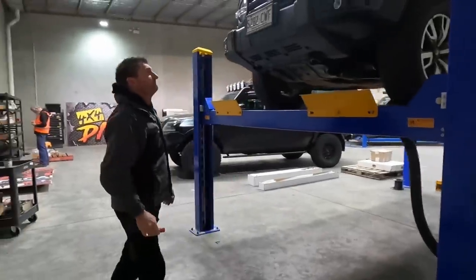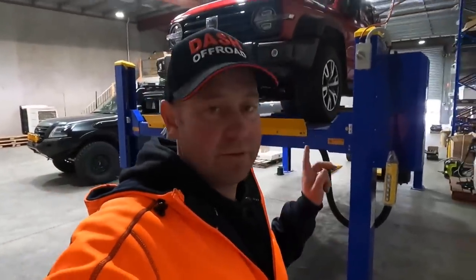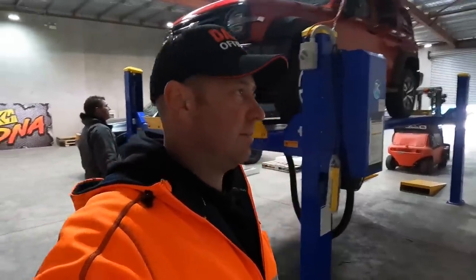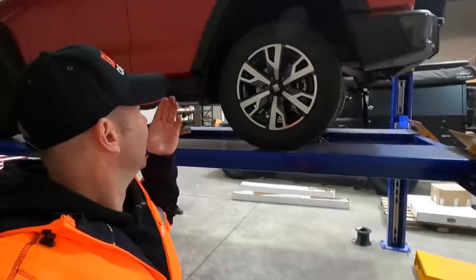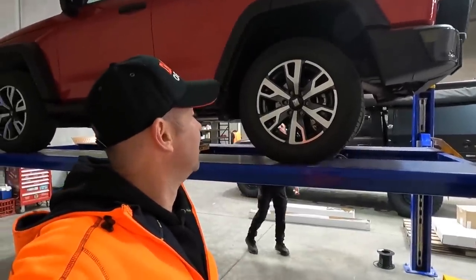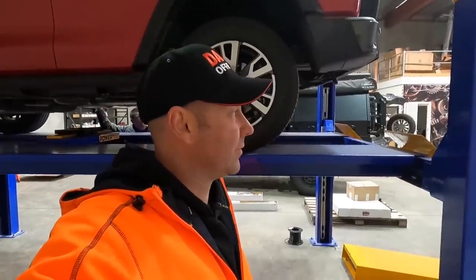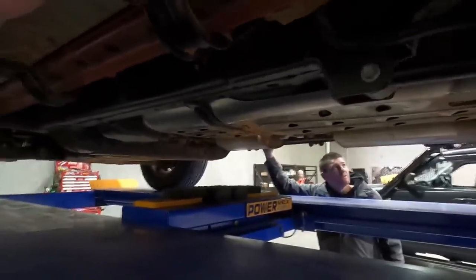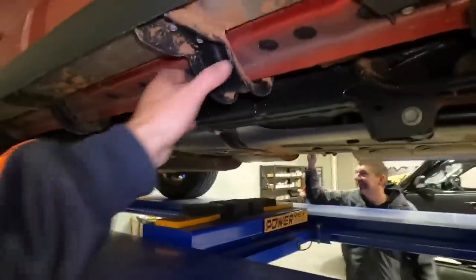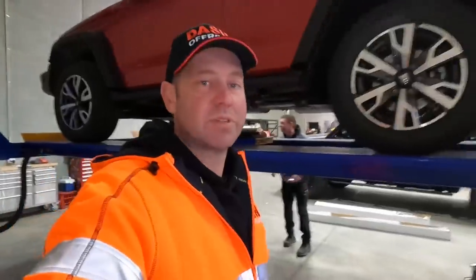Well, I'm impressed, mate. Alright, we've got the tick from Steve. I am giving it the tick. So, what I'm going to do if I get some time this week is change tyres and rims. The big question is what offset. I believe they're plus 40 from standard. My first idea was to put a plus 12 offset to get it to hang out a bit more. However, look at the guard — if we get flexed by upward travel, it's going to rip the guard off. So I might do some tests today with a forklift, see how it tucks with stock, then go put some rims and tyres I've got laying around here and see how it tucks with different offsets. I think we might get some rock sliders too.